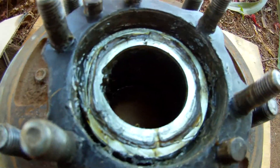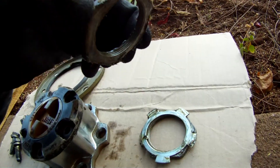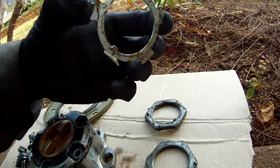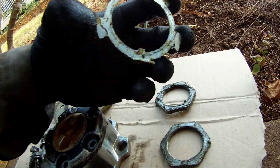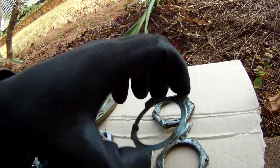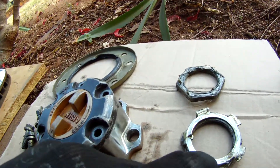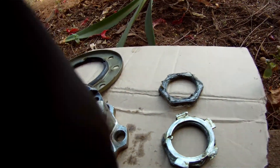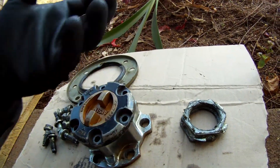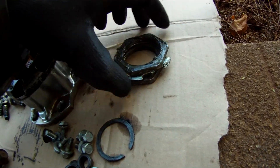There are bearings in there greased up, and a washer. The lock nuts are pretty much identical — I think they're 54mm instead of 52mm on a Land Rover. The difference is the locking washer in the middle has actual tabs that you can flip around, so it's more designed to have tabs bent over, whereas the Land Rover's is just one washer and you've got to bend the entire thing over. This makes it a bit easier on the Toyota. On the Land Rover sometimes it's a bit tricky to get the thing bent all the way down, and you can get shards of metal ripped off that could end up in the bearing. So it's probably a bit better here on the Toyota.